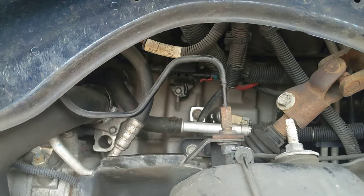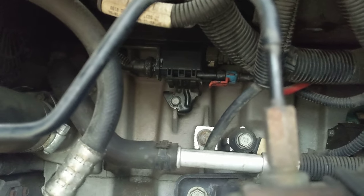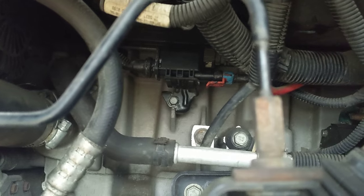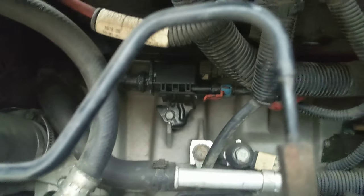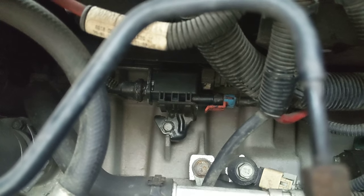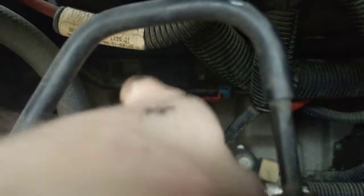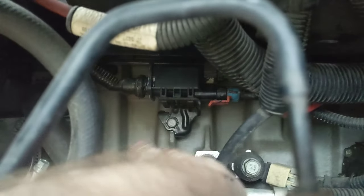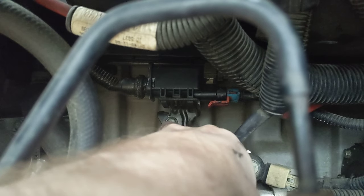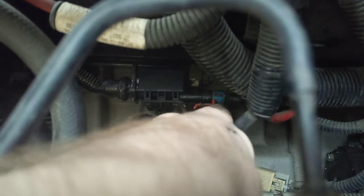Here we have the new bracket and new piece installed. I wound up not using the bracket RockAuto sent me, even though it was a recommended part, because it was absolutely not the right piece. I was able to gently pry off the old bracket and reuse it. I put some Permatex around the left side hose connection where it snapped a little, and once that hardens it should hold. Don't tighten the mounting bolt very hard — it's a lightweight bolt and you don't want the head to snap off. The electrical connector went back on without too much trouble.